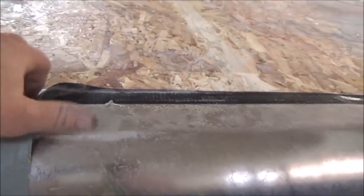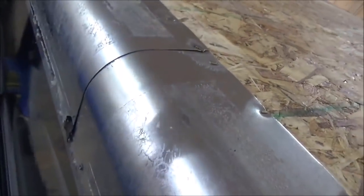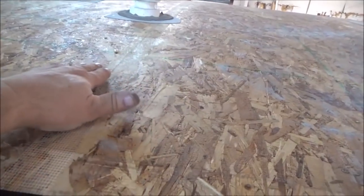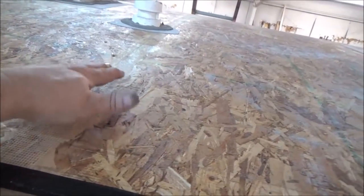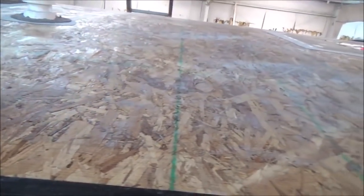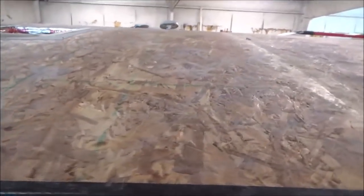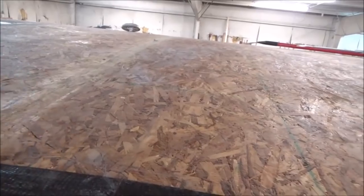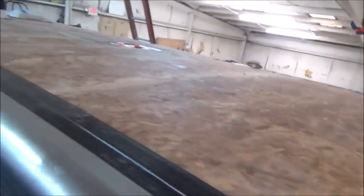That 60 mil is really, really strong, but you still want to protect it because you have these little sharp edges here. As this coach is going down the road racking and twisting, I don't want to poke a hole in there - it'll leak down here and get behind the fascia causing delamination. We like our customers to come back for good reasons, not for unnecessary failures. We want to find the root cause of things and do it correctly. The other place we're putting strips is where they put the drywall mesh - just to prevent the rubber roofing from sagging in that joint and to handle any difference in OSB thickness from piece to piece.